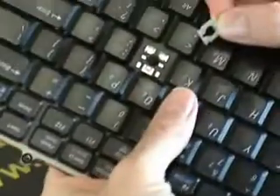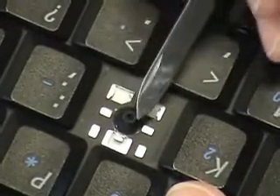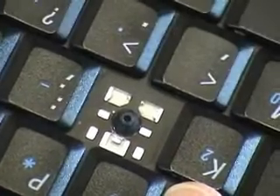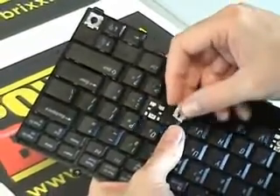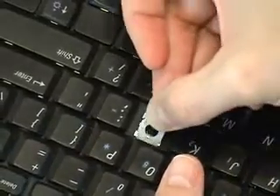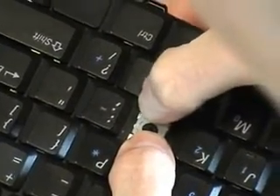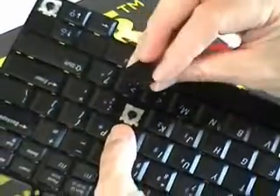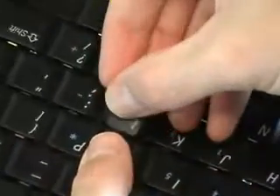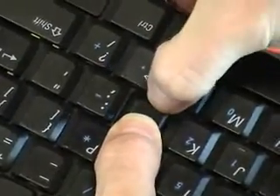To reinstall this, I ensure that all my clips are not bent down. You'll want to take a look at the clips on either side — there may be three or four clips on the bottom of the keyboard that you'll need to examine. Just make sure they haven't been bent down. Sometimes you can take your needle nose pliers and bend those back straight up into position again and get a previously unusable keyboard going. We're going to take this mechanism, line the top of it back in place underneath its big clip, and then push the two little fingers back into place — that's all there is to it. Then I take the key, locate the two slots right above the two tabs, press that down into the right place, then push down on the bottom side until I hear a couple of clicks. And that key is installed.